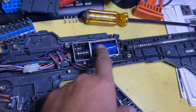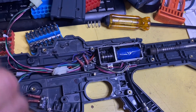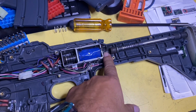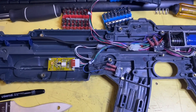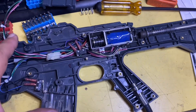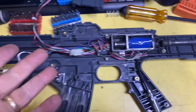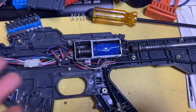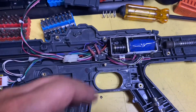I know what you're looking at — you're looking at this little plug right here and this little plug right here. That is the clacker. I don't use that; I actually disconnect those. In the arcade atmosphere this clacker is used so much that it tends to wear itself out, and then I have brass shavings all inside here. It ruins the gun. I don't have time to continuously keep opening the guns to clean this out, so I just leave it disconnected and I don't have to worry about my gun failing due to all the brass filings in there.